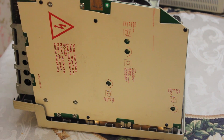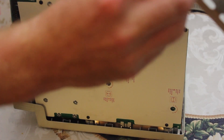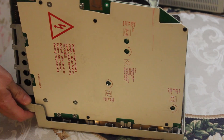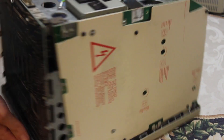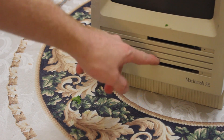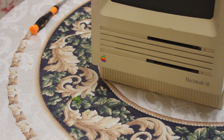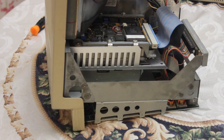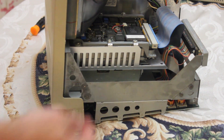We've got this little RF cover — very nice. Revision B, so it didn't take them too many attempts. Now this is very interesting: this one actually has an expansion card and it does have a hard drive. Something interesting about this Mac SE is on the front you can see it's a dual floppy model. However, one of the floppy drives inside has been removed and replaced with a hard drive — that's an aftermarket addition, at least after it was first sold from the factory.